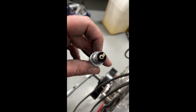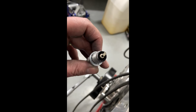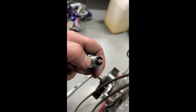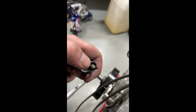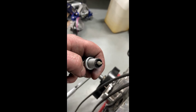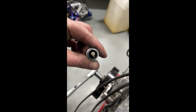So in this case, even though the air fuel ratio from the dyno chart said it was lean, it's not, it's rich. And the timing looks like it's about right. It said 36. By the way, if you have an end here, usually it means you have too much timing. That's weird, because you could also read it by looking at all the plugs, and you'll see them different. Some were right in the center and this one's almost at the end, just because some cylinders get hotter than others. Anyway, that's how I read it.